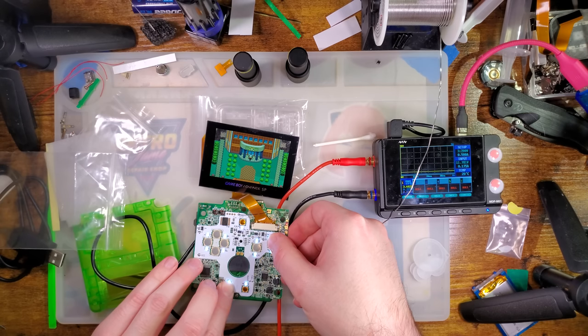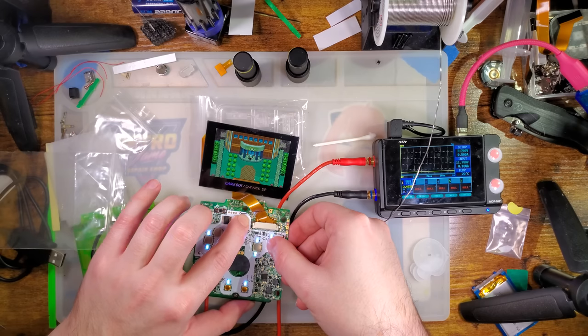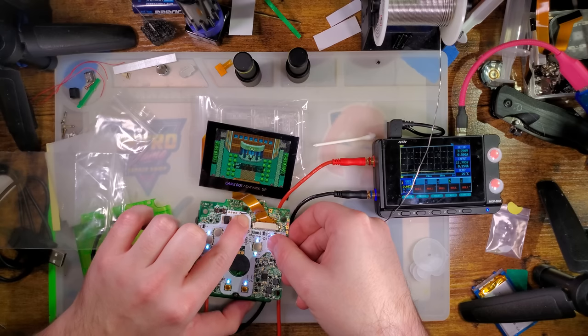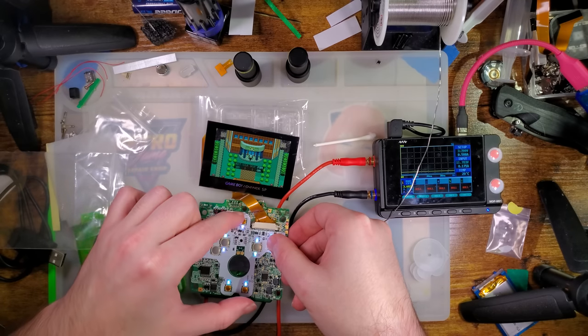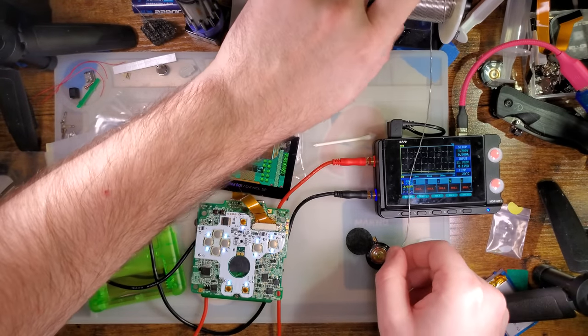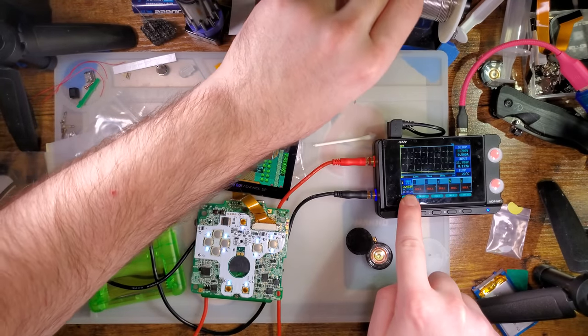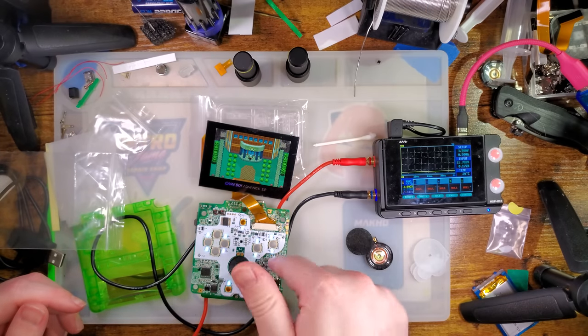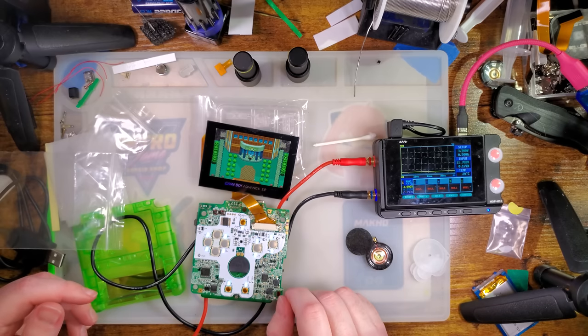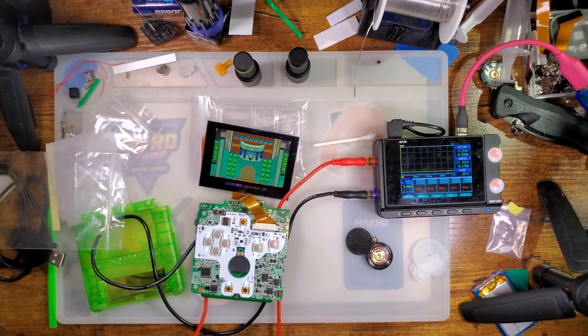I don't know what mode we were in, but we were in the wrong mode. Okay, so max LED brightness, brightness of the screen all the way up, and FRM on, worst possible combination here. The console's only maxing out at 230 milliamps, so this LED board does basically nothing for power usage. There we go, now we know.